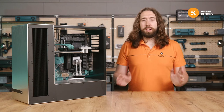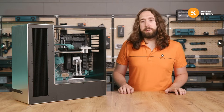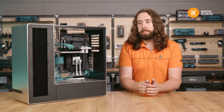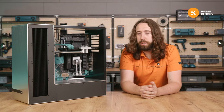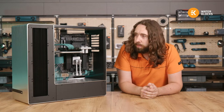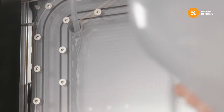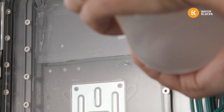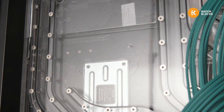So over the weekend, a really long weekend, I put lots of hours into it and finished all of the cables. This morning, I pressure tested the loop with air and filled it on camera this afternoon, so you'll be able to check that out. Didn't fancy doing it live, but as it happened, it went really smooth. No problems whatsoever. Leak test passed at half bar and filling was straightforward.